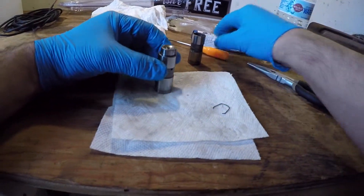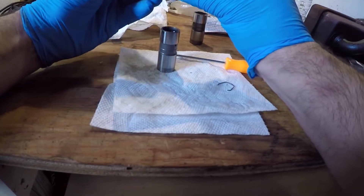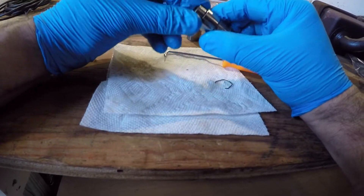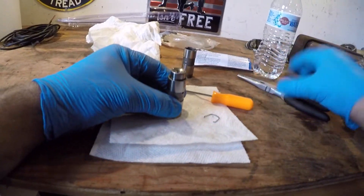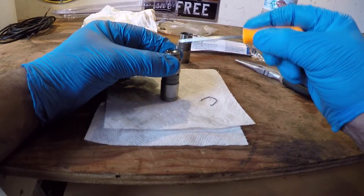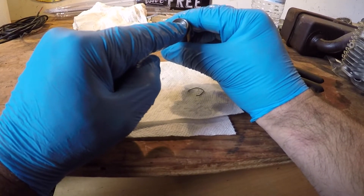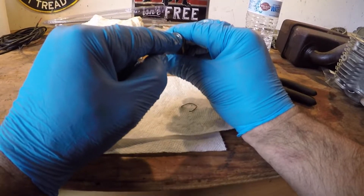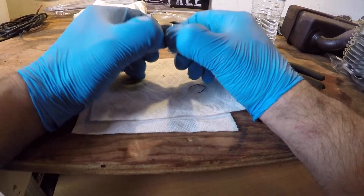So after taking this apart, the spring — this major big spring — is just sitting in there. That's your spring, and here's your clip. The push rod will sit right in here. It also, I think I showed in the last video, has a hole in it — the oil is pumped from the engine through that to the valve, so it gets up to the overhead valves.